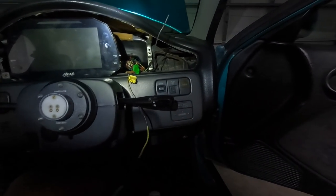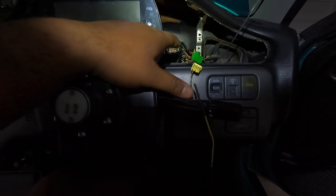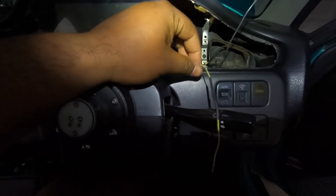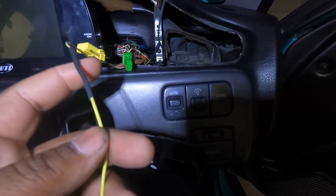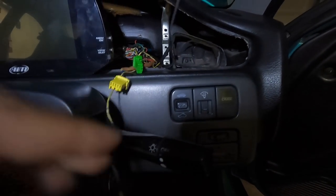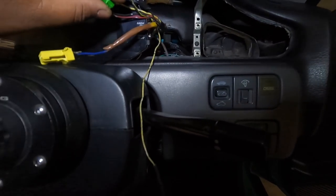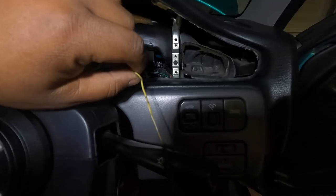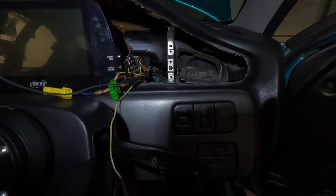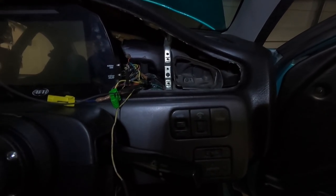It comes with the unit, a yellow wire, which on my harness, on the cluster harness, the fuel sending wire is also yellow. All right, so make sure you just heat shrink that, attach it. This is in the way, so this looks like it's that, but no, it's not. You see, yeah. So this is my wire for my cluster harness, which is the fuel gauge wire. You can pull up a diagram for your make and model. I'll leave the EG diagram link in the description.